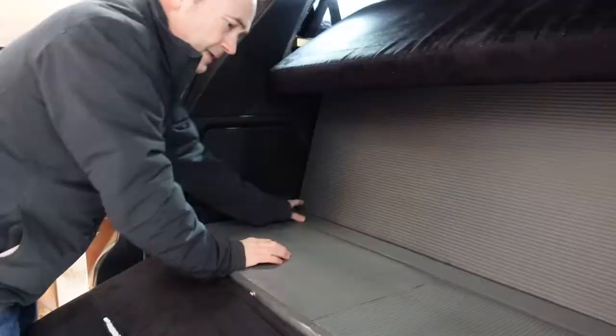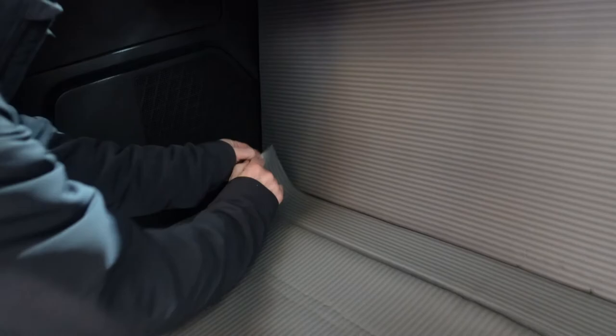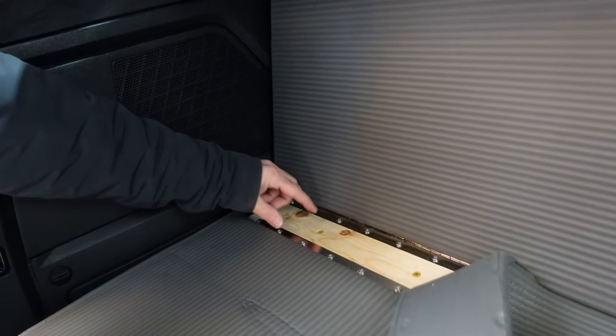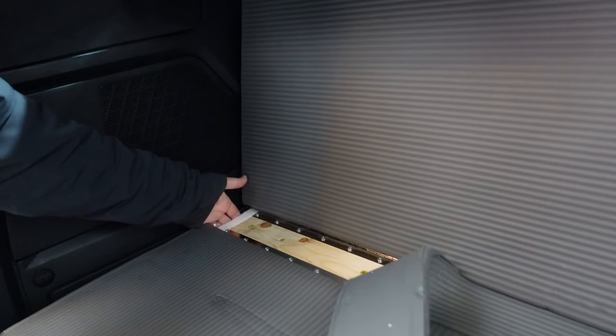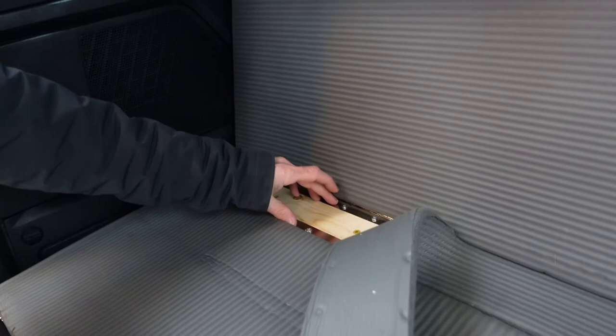This part here is 12 inches and the hinge is there — that's what allows this to go up and down. This extra four inches, and then this solid piece here has a hinge here and a hinge there. This is a 2x4, so it's three and a half inches. That's screwed into the beam that goes across here, giving it structure, then screwed in at the end so it makes an H shape. This goes from front to back and is pulled down into the floor. This piece ends up being wide enough so that with the depth of the cushion, this can fold up without having to remove all of it.